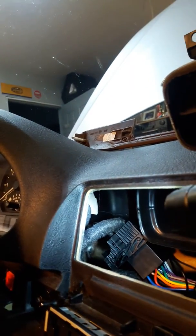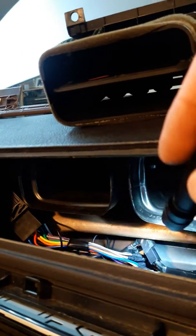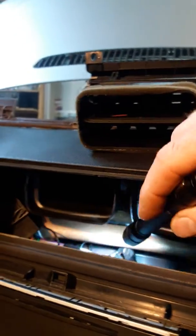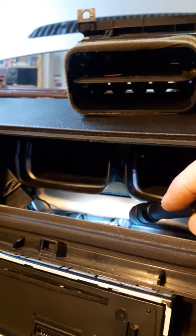You just got to fish the wire over here first, run it over the top of the radio between the air ducts, and then go down the back. Make sure this is clear so this blue cable can run in there. I taped my radio antenna connection — for some reason that was a good idea. That's a real bitch.